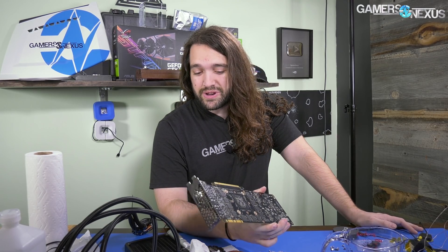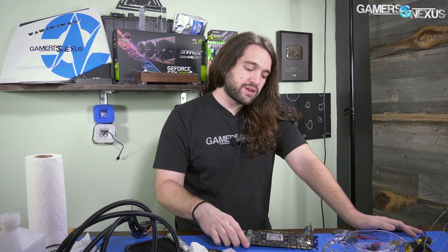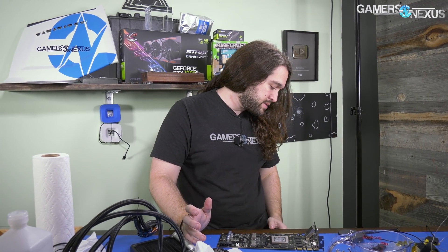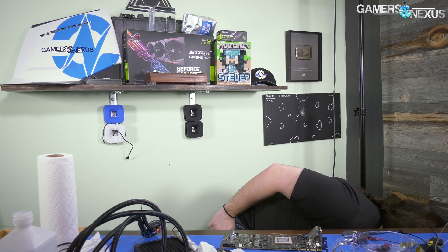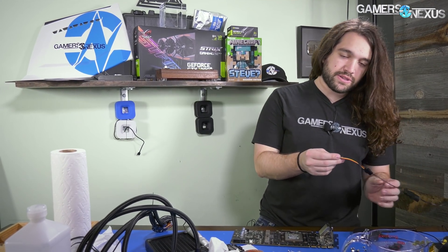If I blamed the cooler, I wanted to be sure about it. VRMs should be fine because it wasn't the VRM that was overheating. I have to go with loose contact or something like that. I'm going to put a different cooler on here, test it, and see if the temperature comes down. Just thought we'd do some diagnostics — I had to do it anyway, might as well film it. At the very least you get to see how much liquid is in these coolers, so if you empty your own you can check against ours and see if there's permeation — it's about 100 milliliters, and as long as the pump spins it seems like another problem.